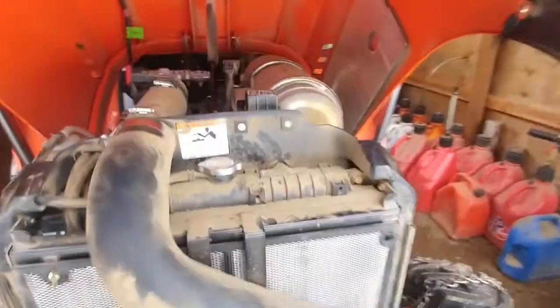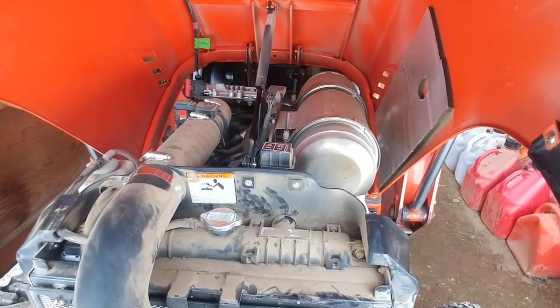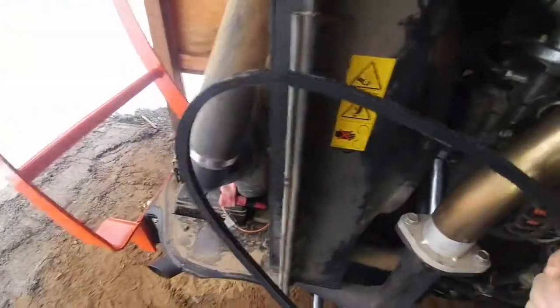So that's why I chose to fish the belt between the fan shroud and the fan. Not easy at all — you have to make do and sneak the belt around things so you don't have to take it to the shop for something so simple. What I do is turn and rotate the fan, getting a little more gap at the top, working more of the belt to the other side until — boom — just like magic, belt's off.